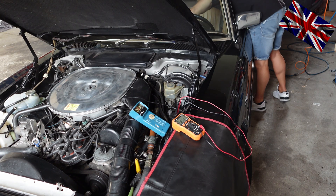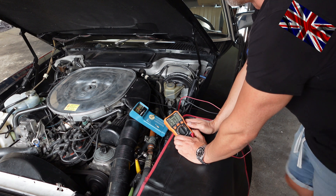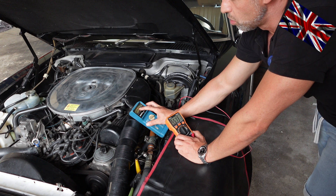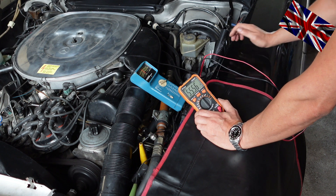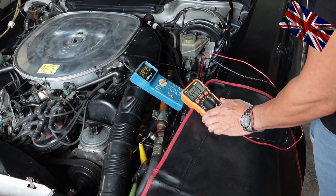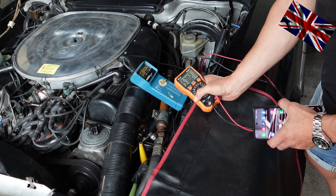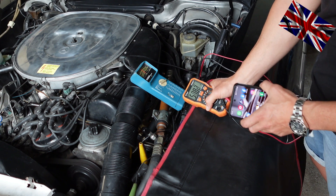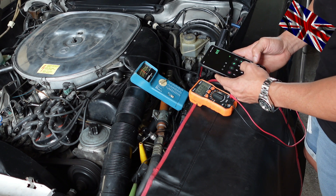Concerning the blue Bosch — the needle tells me the engine is doing 800 RPM. The other multimeter is set to Hertz. You just have to multiply; another factor is the number of cylinders that needs to be factored in to receive the precise number of rotations. This being an eight-cylinder, you multiply by 15. The display shows me 55 — using the calculator: 55 multiplied by 15, the factor for eight cylinders, results in 825 rotations per minute.